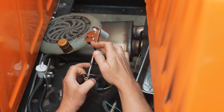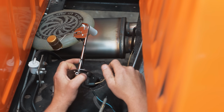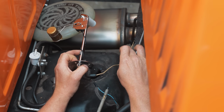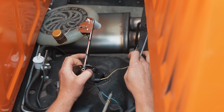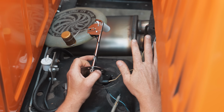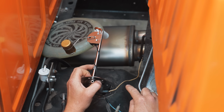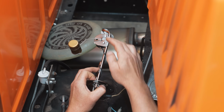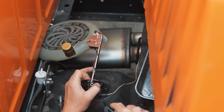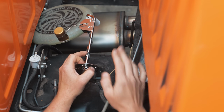But with this being open, we're not really loading this ground. So that 0 volt reading we had was not accurate, in that checking that ground on the frame was never under load. That's the downside of a voltage drop test. The ohm meter would really be the better measurement with this fault inside. However, what we did was enough to say go inside, but I'm gonna redo this check on the ground now that we have a complete circuit.